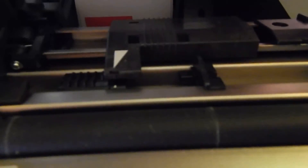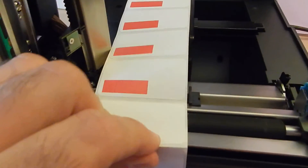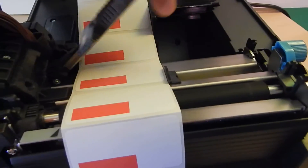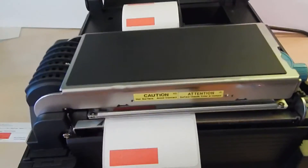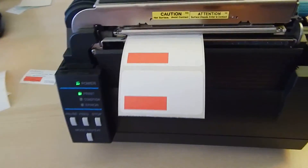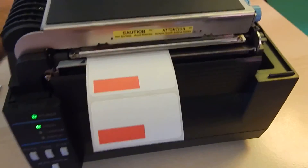So I'm going to pull this arm back, lock it, fold the paper down, put it right over the edge, bring the bar on top, keep the labels inside the stop sensors on either side, just put it in place, lock it, and close the lid. And again, if I had an auto cutter, I would feed this through that auto cutter too — it's just a little hole, you stick it right through and it's fine. At this point, I can do a self-test to see how it prints.